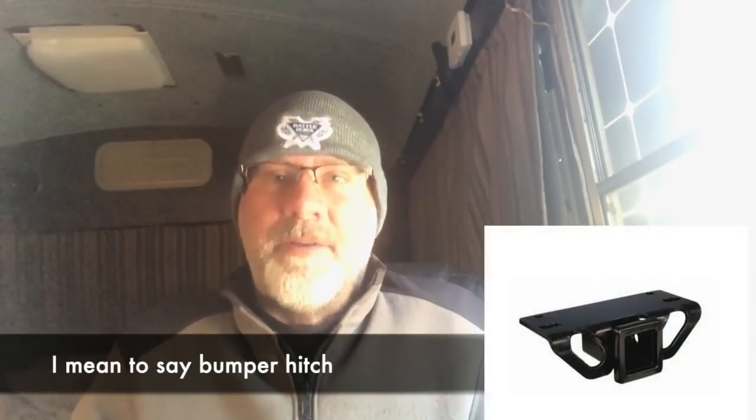In fact, I was thinking about getting a mounting plate for it, taking the bumper off, removing the hook and mounting a receiver right there, just a custom receiver coming out of one side, probably about a quarter of the way into the bumper of the vehicle. From there I could use a tree strap around a tree when I've got one available, put a snatch block on that, and then hook back over to the other hook, so I'm pulling from both contact points.